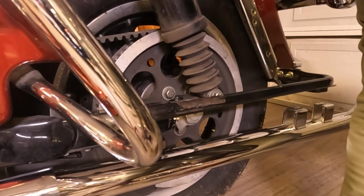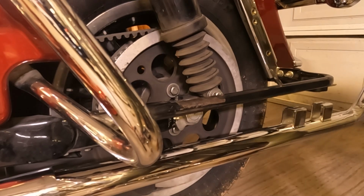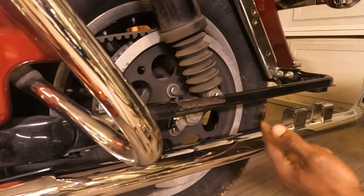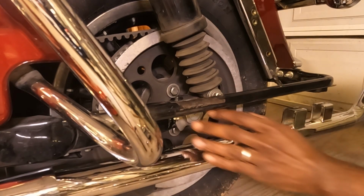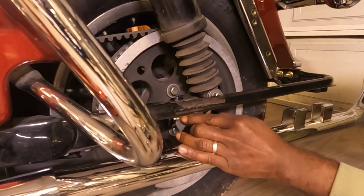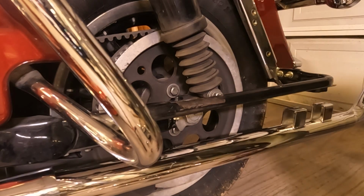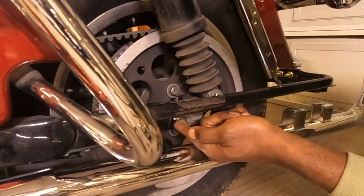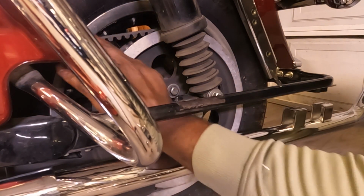And then I did the same exact thing on the other side. I have the tire jacked up just enough to where I can still get some rotation. We're going to go to the other side, and then we're going to take our time. I also loosened this slip-on to give me enough room to get inside of this, all right? So that's the thing that you do first. You mark this, so when you're done, you try to get that line back up, and that will give you your marker points of where this thing needs to be. There's also a little line here that if you mark across to that line, you also have the accessibility to make sure that this belt is where it needs to be.